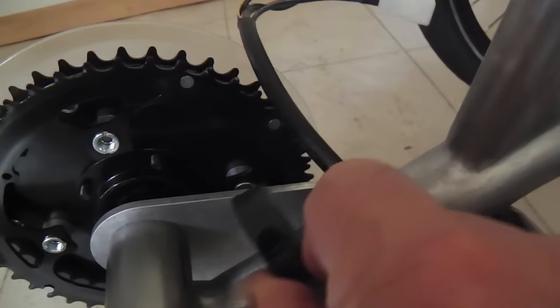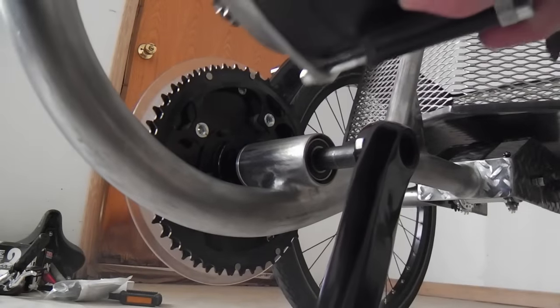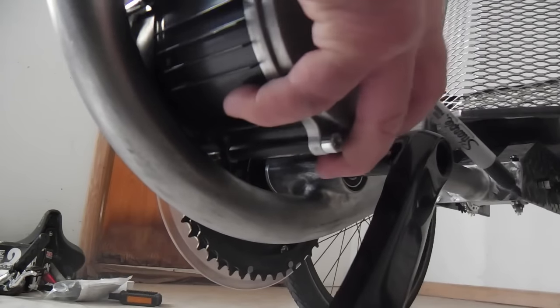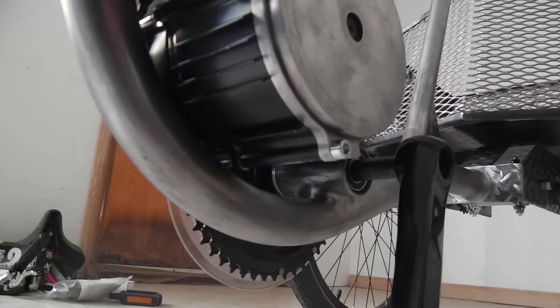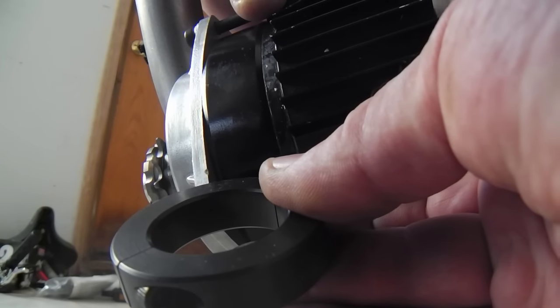It's not fixed. So I'm thinking I'll just put a couple of these big split collars. These tubes are one and a half inch diameter. I'm simply going to form a reference point for lining up this motor and this chain line to it — there's the sprocket, there's the outer sprocket. We're going to get them lined up. The best reference point I can have is on one of these bolts. I'm simply going to mark a line. Once it finds its spot and you clamp it down, it won't move in conjunction with the other one.